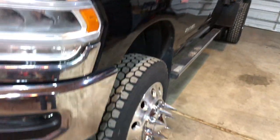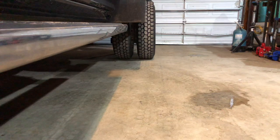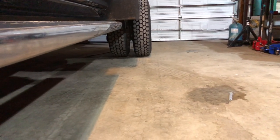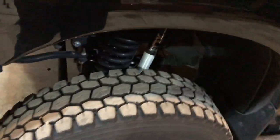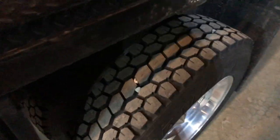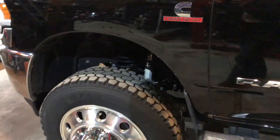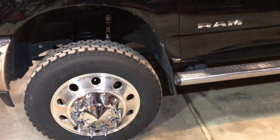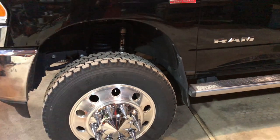A couple pros and cons — the only cons and complaints I have: the big gap in the rear, which is why on the next build I want to go with 275/70 instead of 255/70 for a wider section width. I also don't like that these tires, being an open tread pattern, are going to pick up rocks. If you're hitting a lot of dirt roads you're going to pick up rocks and hop on the freeway throwing them at cars behind you. Definitely recommend mud flaps with an open tread pattern, or you will chip up your paint. Steer tires up front with straight grooves would pick up significantly fewer rocks.